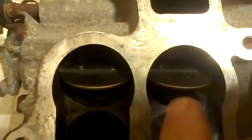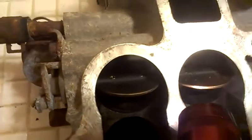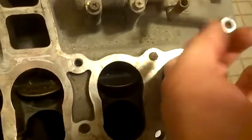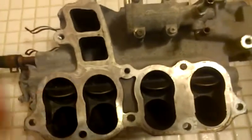Right all in here, so you can see that there's no smooth transition whatsoever to the back side of the butterfly valve. And if you stick your finger back in here too, it's sharp — that shouldn't be. It should be a nice bell mouth for a smooth transition.